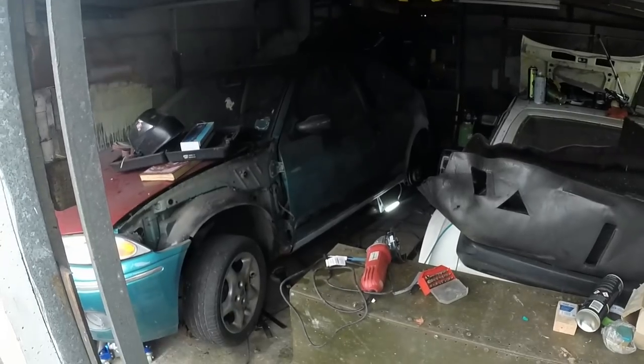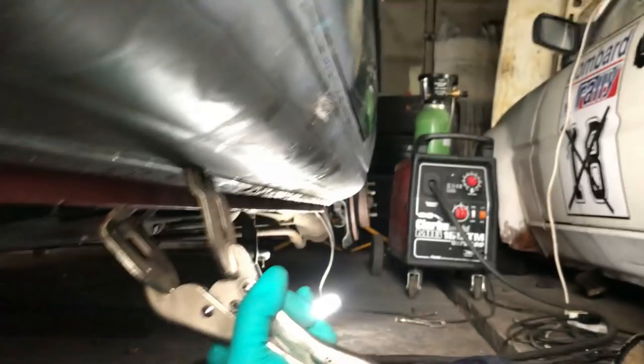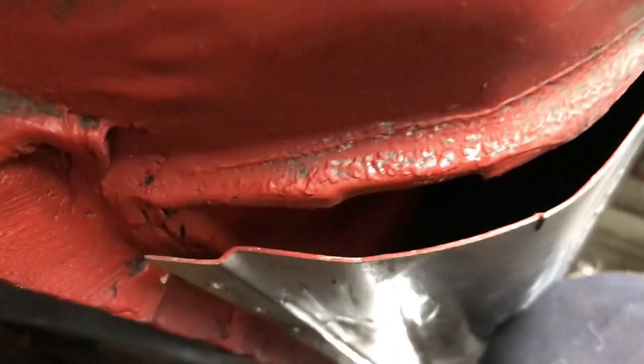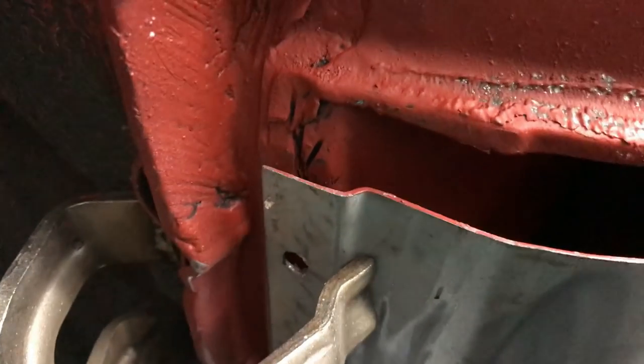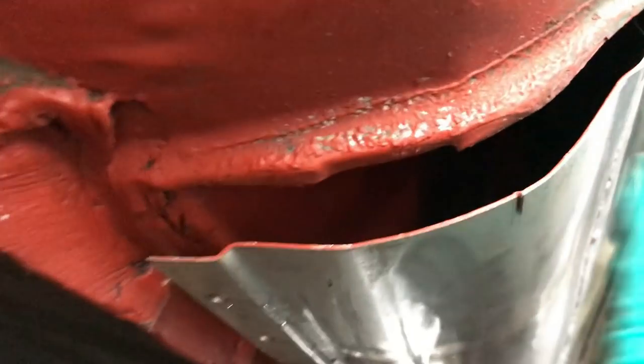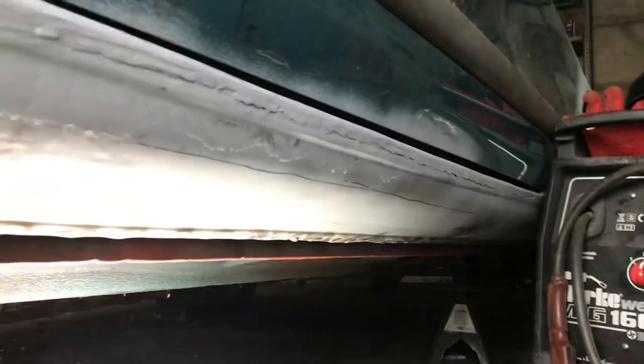Then I've just got two days to do all of the other side. Just another subtlety to this - I'm trying to get that seam along here as straight as I can. That's the shape I was trying to replicate and I'm pretty much there. Just needs to belly in a little bit, so I'm pushing it with my knee and pulling it across with the grips. With enough hand strength with two hands I can just close that up so that line is parallel and this profile sits right. It's taken a while but that's the full length of the underside of the sill plug spot welded in.